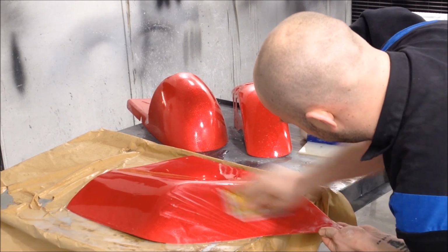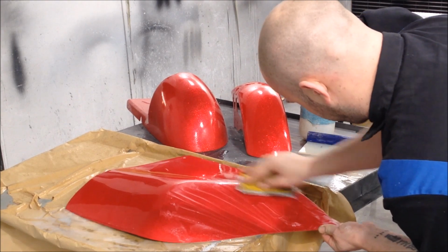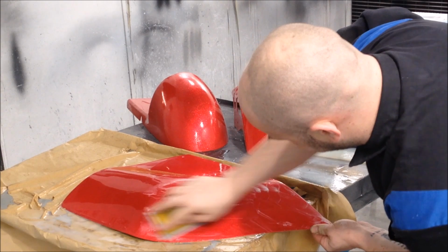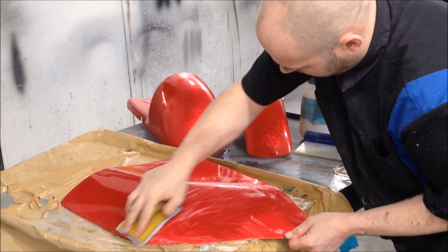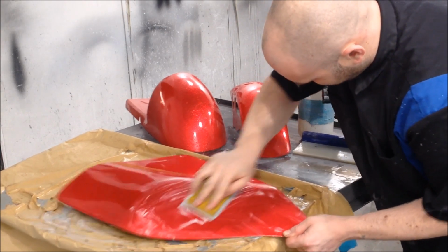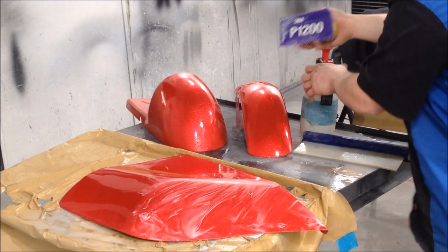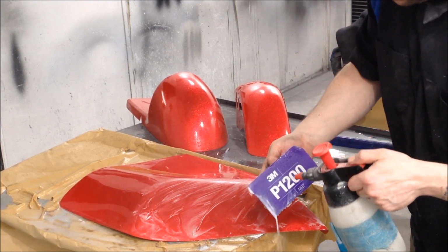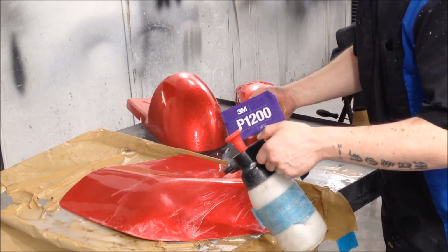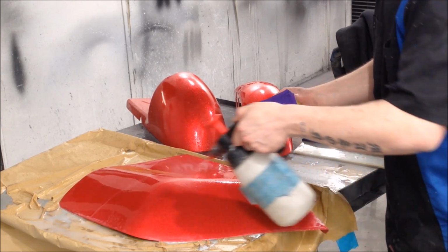So keep remembering as well, you crisscross pattern, do that all the way. Alright, all the way through. Do your crisscross patterns. Best practice, remember. And you want to, like I say, keep it clean. You don't want to clog up your pad. There's another way you can tell your ClearCoat's cured as well, by the way, is that your sandpaper will come off clean, nothing on it.